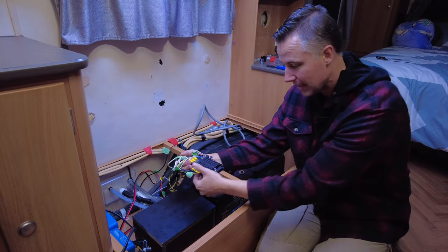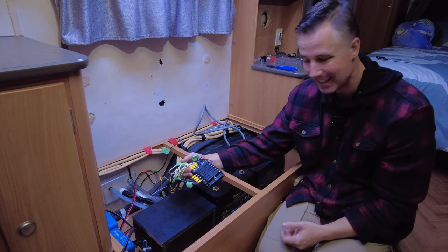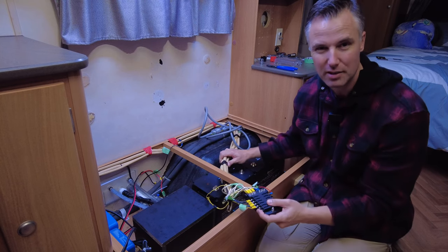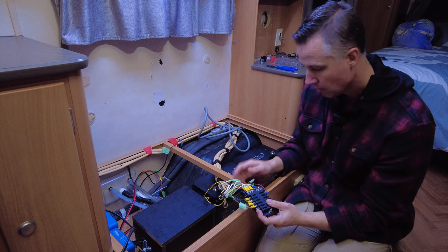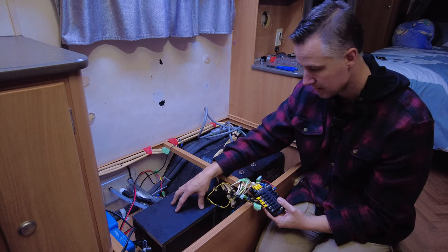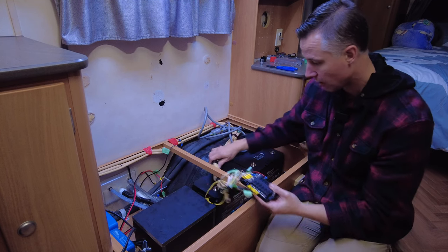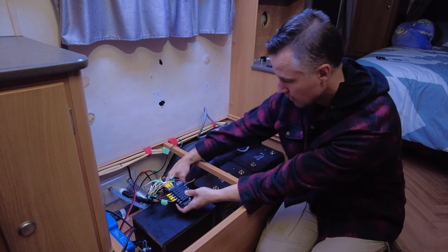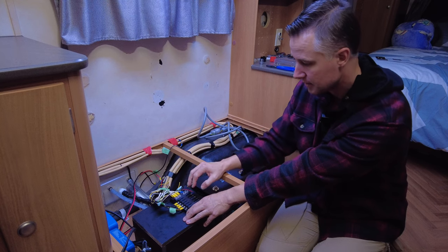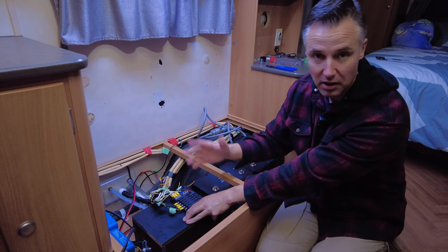Slight change of plan. I've gone ahead and wired up the majority of the wires to the fuse block, but once connected it's a little bit too short. I didn't want to drag the wiring across the batteries — it would just look messy. So I've come up with Plan B: I've built a little box out of 7mm form ply that looks a bit like a battery. I'll mount the fuse block to the top so it's easily accessible, and it also hides the mess of hoses Jayco put in the floor and tidies the area up.